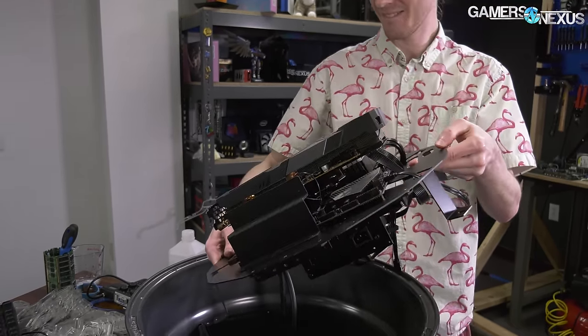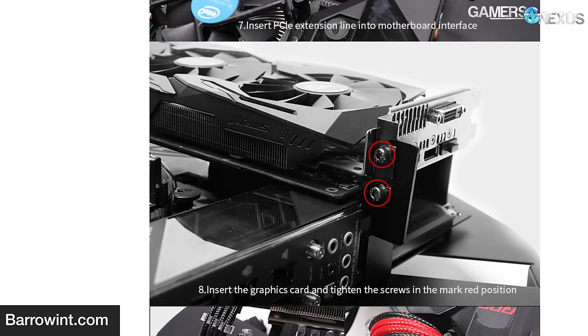The case layout is extremely rigid. In order to make a usable system without breaking the rules, you have to use an ATX power supply, you have to use open-loop cooling, you have to use a vertically mounted GPU, and two radiators mounted barbs-out with tubes routed through a specific cutout — with fans arranged as intake being the only option for cooling. Modding the case is always an option and is probably what you should do with this product, but for this price it'd be more economical to just buy a literal rim and start from scratch. You might even be able to do a better job with the mounting. Barrow does make multiple mentions of air cooling support on its product page, but again, it's a terrible idea.